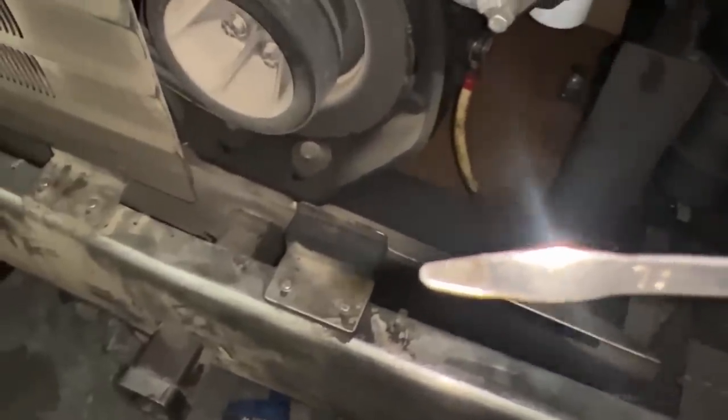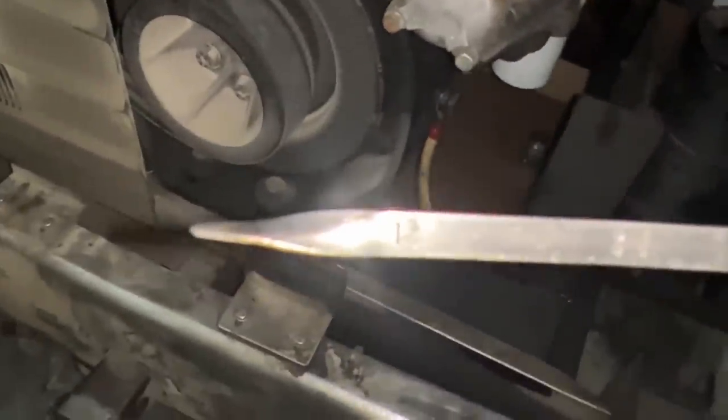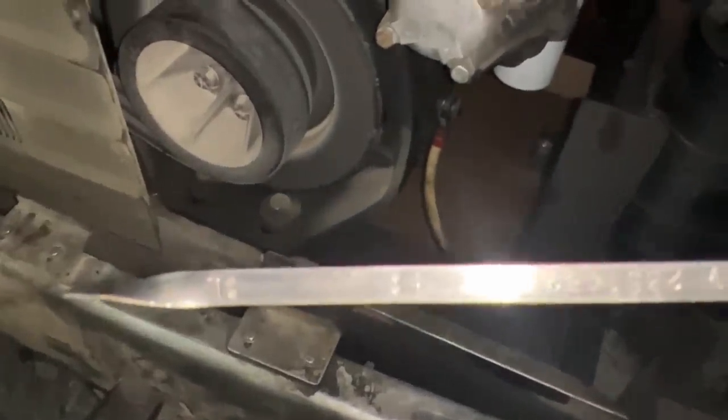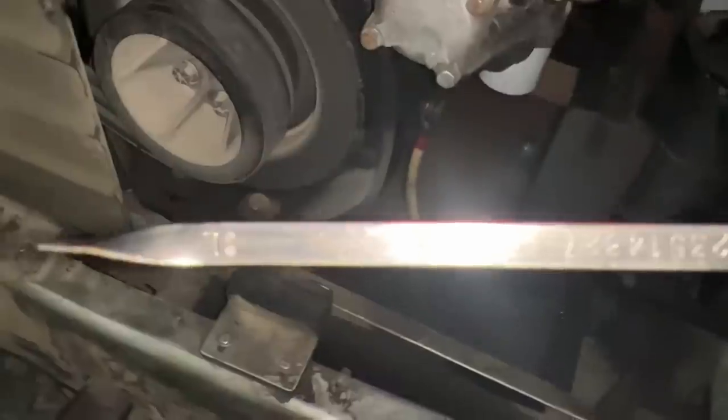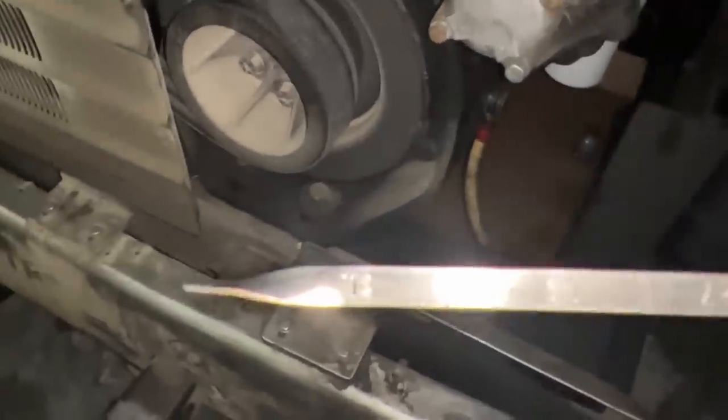We actually have 11 gallons of oil on this engine right now. And I don't know if you can see, but it's just that little drip on the end is where it's registering on the dipstick. The low mark there, the L, that would be about 1 inch, or maybe a half inch above the oil pan gasket. And then the full mark is a good 2 inches above the oil pan gasket, which is why he was leaking so much oil, because he was trying to run it full and he knew something wasn't right. So the dipstick is way too short